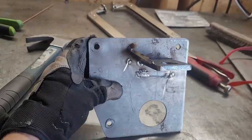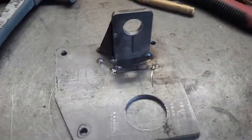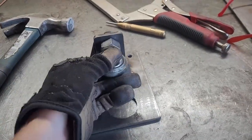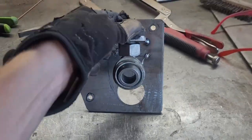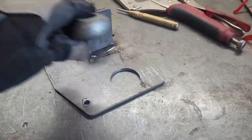Alright, so we got the pass-through all welded up — I had to do it a couple of times to get the spacing right, and it's still kind of a guess until I get the dash bar support on. This is what we have: three mounting holes that bolt to the firewall, our pass-through tab, and our pass-through hole. Basically the shaft sits through here, with a jam nut on the back side. That guides the steering shaft through the firewall and connects it with the U-joint on the opposite side. Now we just need to get the dash bar support sorted, and once that's in we can get the main links correct, get them tacked together, and put them in the car.